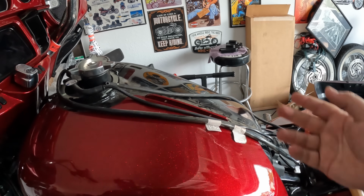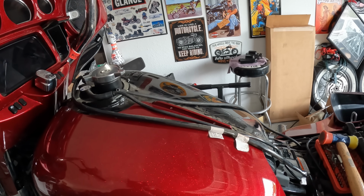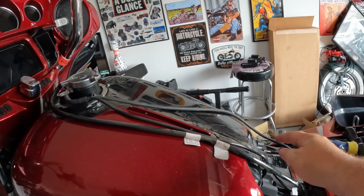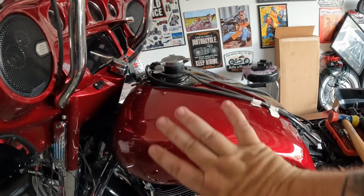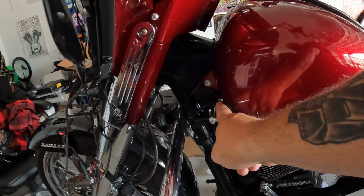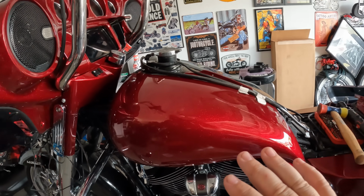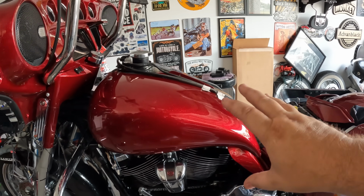If you have an Ultra, then you may have a CB line or stuff like that. I just took all that crap out of this because I'm never going to use the CB or the wired intercom. So you take your dash off with those 2 screws, and then the tank cover goes over the tank and uses the stock mounting bolt and then bolts to each other up here. I mean, that's it. It's hovering over the tank. It's not glued on. I've done those before.